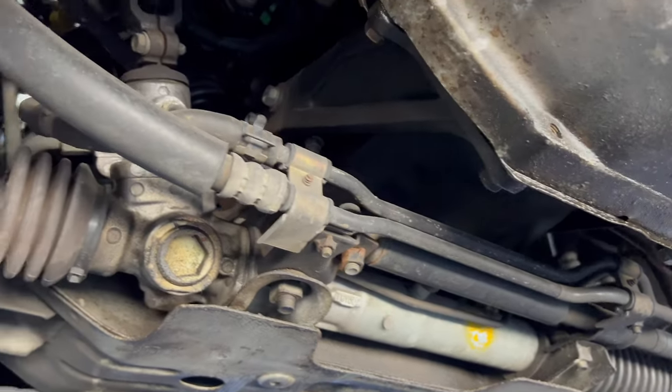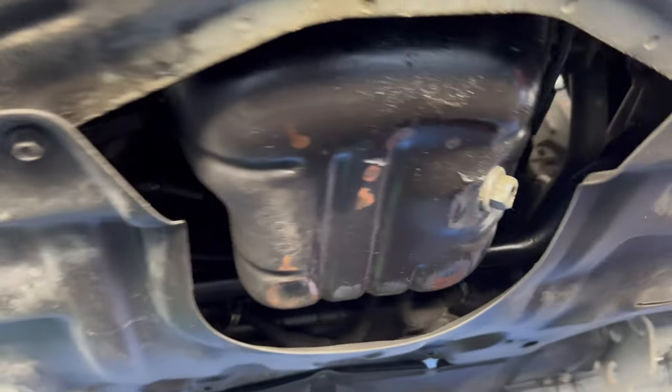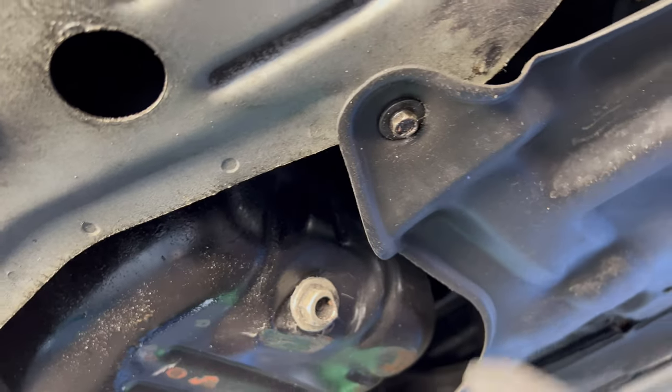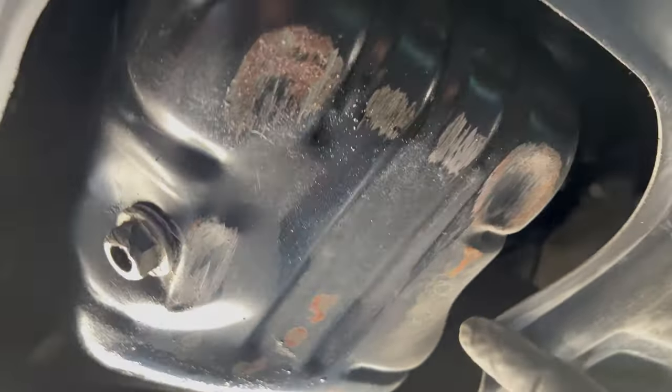And then we got some leaks here. This could be the rear main seal. I know the front main seal is leaking, typical stuff. Here's the oil drain plug, and we have a little bit of a scrape right here under the pan, and that's why we're gonna try to pop in those Rude Boy Custom engine risers today to save the rest of this pan and not fully destroy this thing. But anyways, I think at this point we're gonna get started on the front lip, so we're taking a quick look under here before we get into that, and then yeah, we'll see what we're working with.